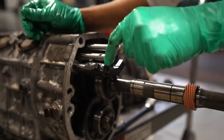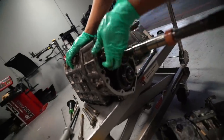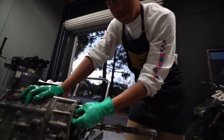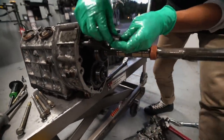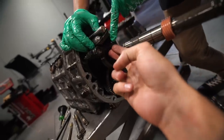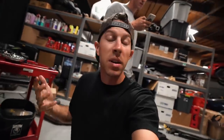I also found that this thing is doing something it's not supposed to do — TJ called Louie about it. I pull it out, and there's the pin — the missing pin — and I heard a little clink, which might be another pin. So your fifth gear was missing a pin: it must have fallen out, and this is what controls fifth gear. As it fell out, the shifter rotated down and got stuck — there's a gap now that should never be there — and it got wedged in between fourth and fifth, which is why TJ couldn't get the shifter out of the fourth-and-fifth area. The dowel pin that keeps it from rotating fell out.